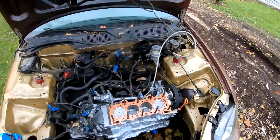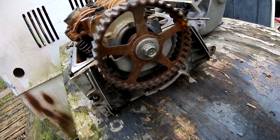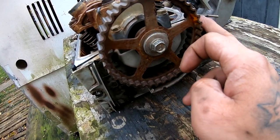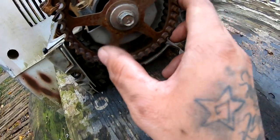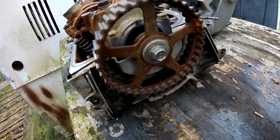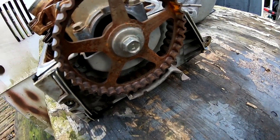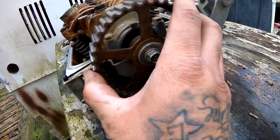I'm gonna go get the head and drop it on there. One more thing I forgot to mention — before you drop the head, make sure the two little marks are nice and even with this guy. They don't have to be perfectly even but make sure they're facing this way, and this one has an up sign — make sure that's up. Those are your timing marks. You want to make sure it's like that right now because you don't want to start cranking with your pistons in the up position, because then you might scratch something. Always make sure your timing is almost ready to go.